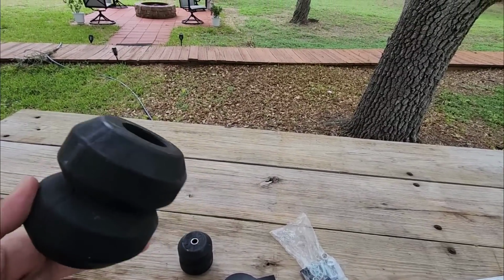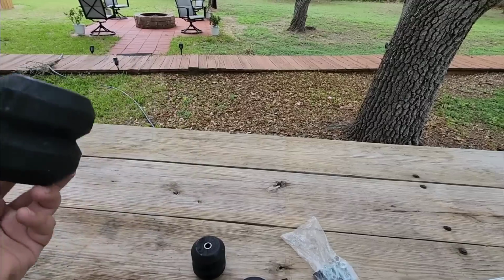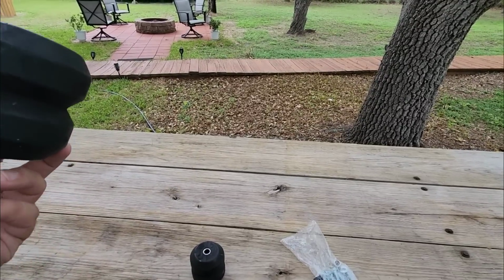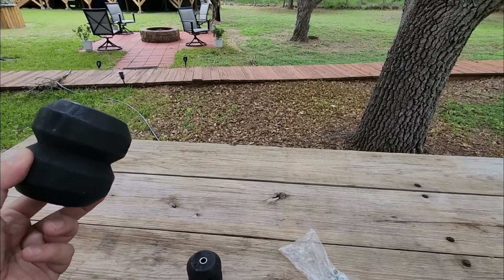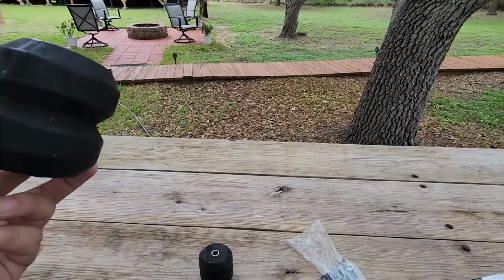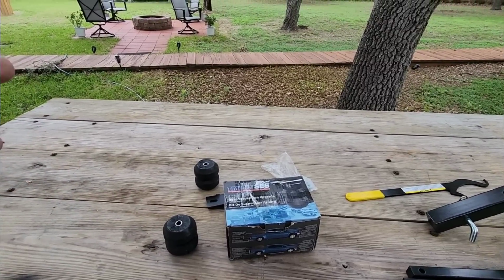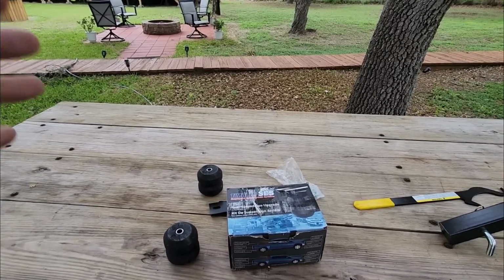Well, because there's a lot of pickup trucks that fall into that category. Basically, you get a pickup truck, you load it full of weight, and then you realize that it's sagging even if you're not exceeding your truck's cargo capacity. And part of that is because a lot of trucks nowadays are designed to be very comfortable. They're designed to ride more like luxury SUVs and less like pickup trucks.